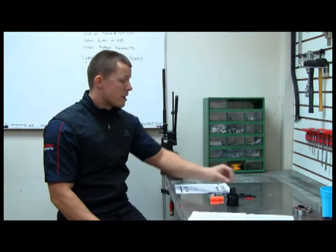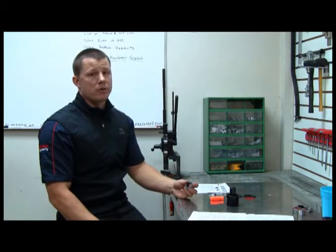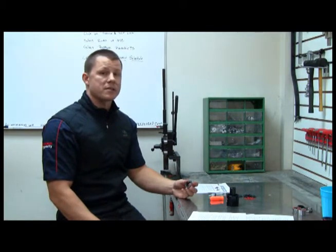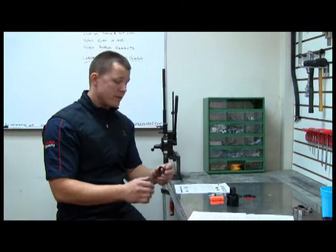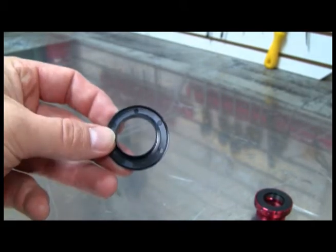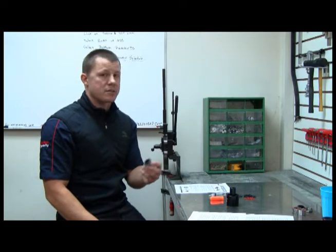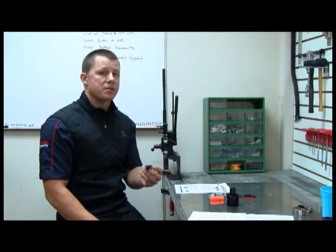You may have also noticed I have extra bearing covers and bearing seals. These can crack or tear when you remove them, so it's especially handy to have extras in case that happens. Also, if you have the older style bottom brackets, they have a top hat style bearing cover. It's virtually impossible to remove these without cracking them. So again, having an extra set on hand is going to make the rebuilding process run more smoothly.